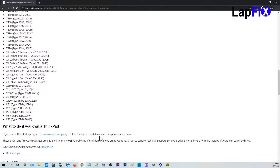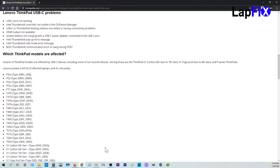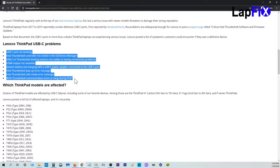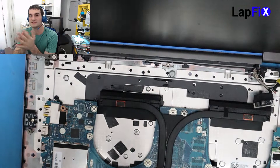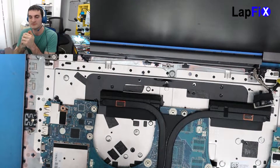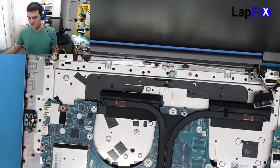I know they're trying to do more drivers and firmware packages, but most of the time these types of issues are more hardware. I would at least contact Lenovo if you have one of these models just to see what they can do for you. The instances where something might happen: it just doesn't work at all, the controller is invisible in Device Manager, HDMI output issues. This does seem more like a hardware issue than what a driver can fix. If you have any glitches with those, try to contact Lenovo and see what they can do.